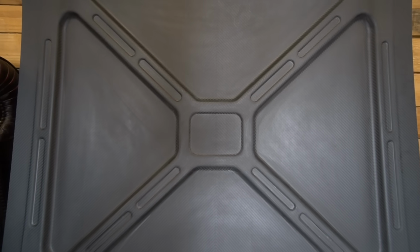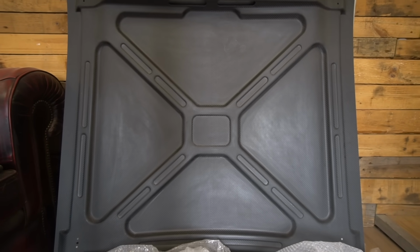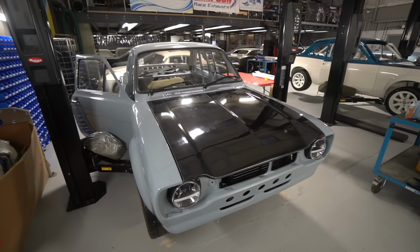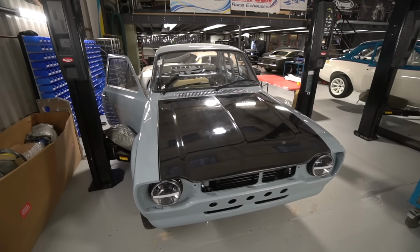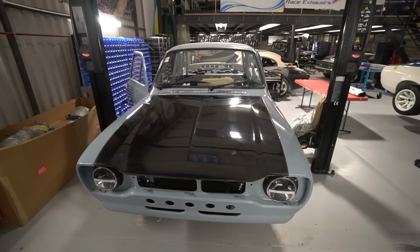So the inners are visible weave, sort of VQ they call it, so visible quality carbon, so it'll have like a herringbone pattern on the weave, and then the outer's just in the body panel system carbon, so it has a sort of coating on it that avoids primer and paint sinkage into it. So the outers will be a painted finish, the inners will be a visible weave finish, so when you open the bonnet it'll be visible carbon on the underside.